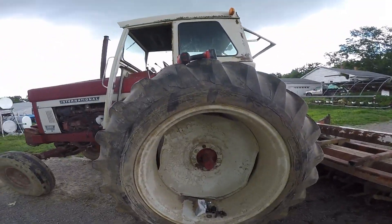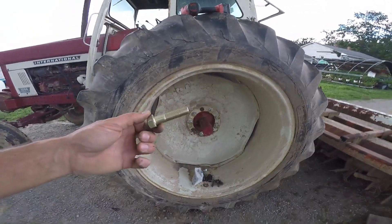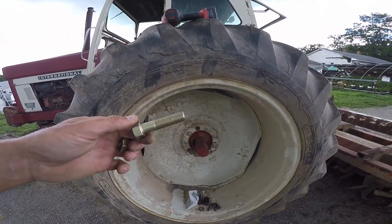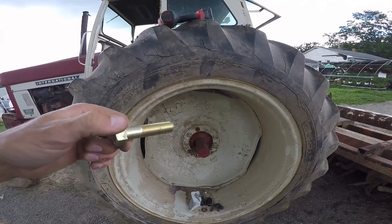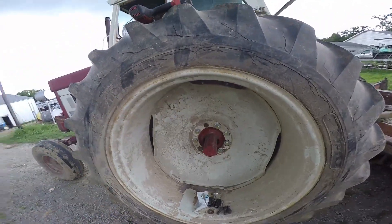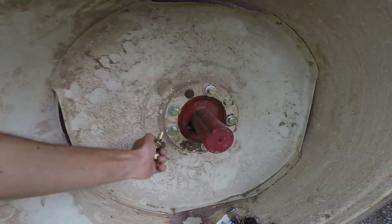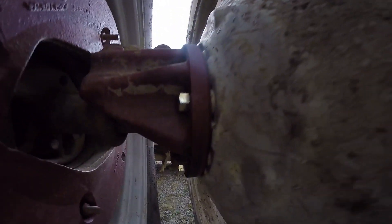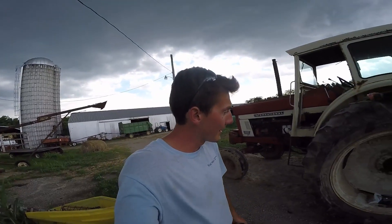We're back at our dual project. Since we stripped those out, I went to the local hardware and trucking supply and got these 5/8 by 2.5 inch, 18 threads-per-inch bolts. Apparently they're grade 10 — so that's really hard. I always assumed they were grade 8s. We've got washers since these don't have a bevel on them, and we're putting nuts on the back side. That'll finish this project up for us. Not as smoothly as I wanted, but I have duals now.